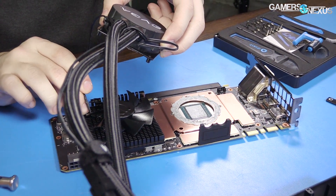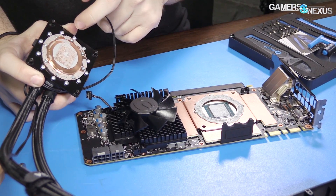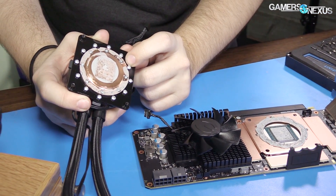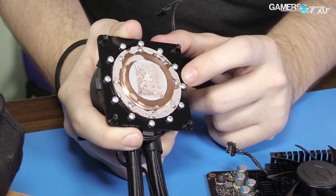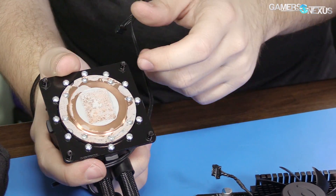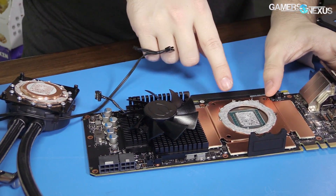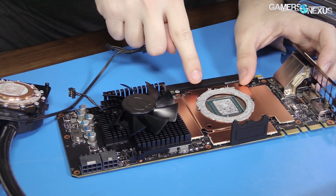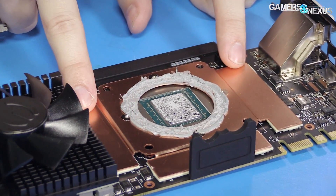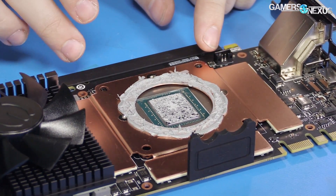Let's detach everything. You'll notice this is the protruding copper plate that we've been talking about for a while — EVGA uses it in their hybrid kit and hybrid cards. What's interesting this time is there's actually TIM on the outer rim of the plate. Why is that? Because the rim here aligns with the rim on the GPU mount. The reason there's thermal paste on the rim is because this copper plate is contacting VRAM here, here, and here.